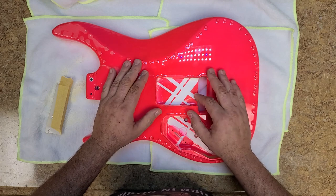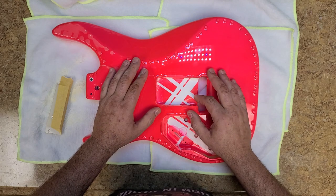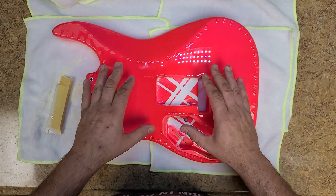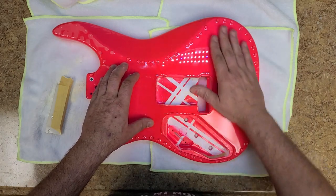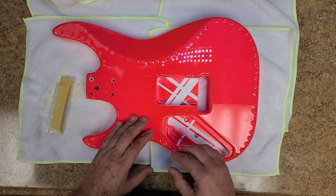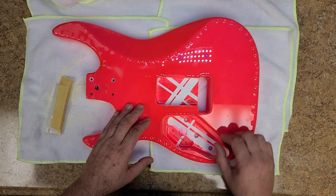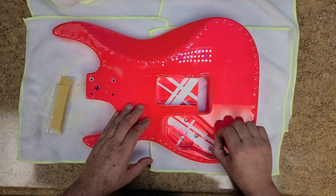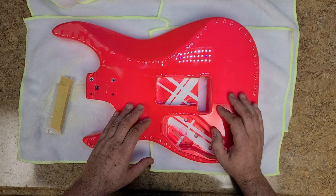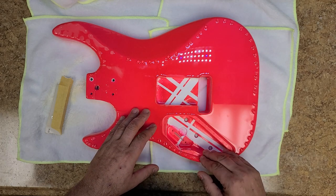So what I'm going to do is tomorrow I'm going to go in the garage, fire up the DA, hit this body with 220. I need to thin out the epoxy that's on here anyways because it's pretty thick around the edges and stuff. What I got going on over here is that the sidewall's built up pretty big, making a good lip up against the masking tape that I had.